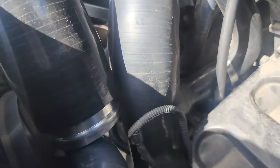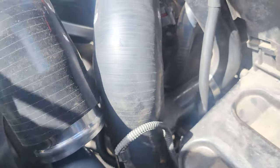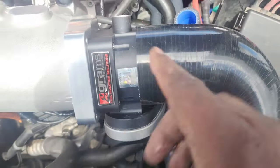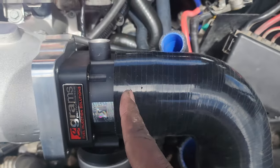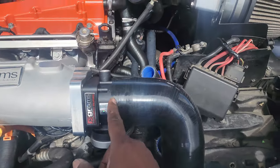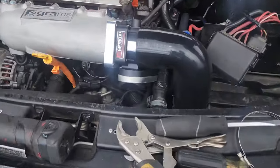To make a straight cut, I'm just going to put a clamp around this, keep it straight, and take a razor knife and cut around it so I get a clean straight cut. All right, I just made the cut — you can see it kind of lines up. I didn't cut this side or this side, so I have room to adjust. I can see I've got the coupler pushed back over the fitting already.